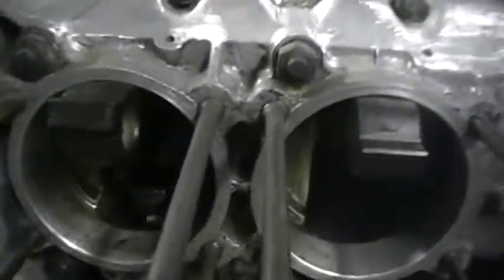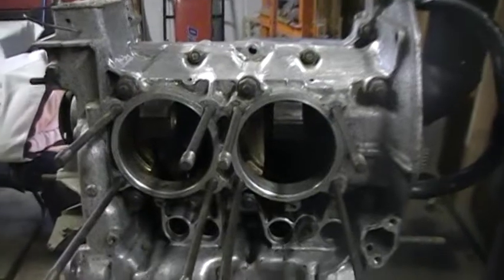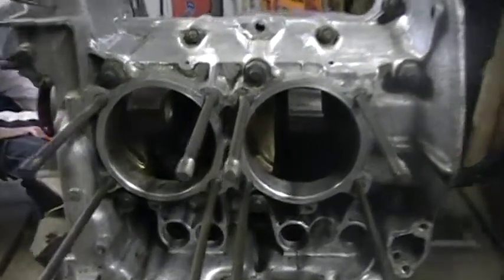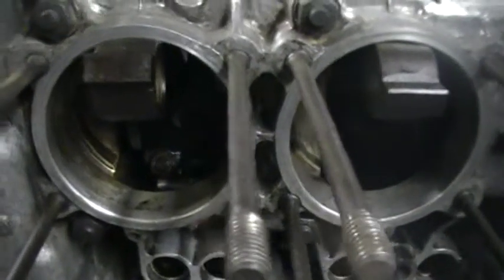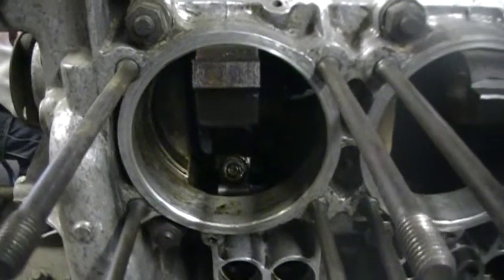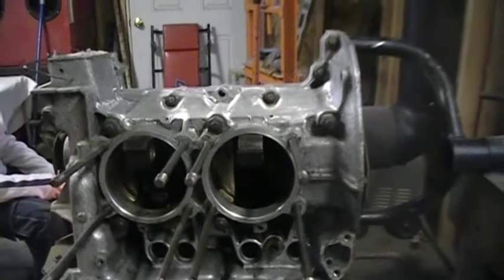I've got a lot of the parts over here that I've been working on — the cooling tins, the fan. Been cleaning it all up and painting it with high temperature paint. The engine had some compression losses, so since the bottom end is good, all I'm going to do is put a new set of pistons and cylinders on it. You can see on the cam lobes — the Type 4 runs forever as far as the basic block goes, but your cylinders will wear out. One way you can tell how much internal wear you have is by looking at the cam lobes, and these cam lobes are in excellent shape. So I'm fairly certain I'm in good shape just putting new pistons and cylinders on this engine.